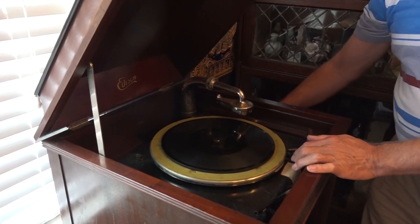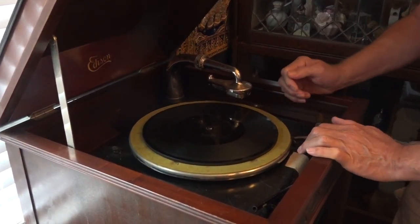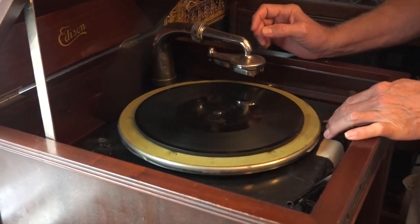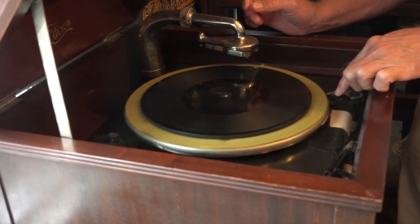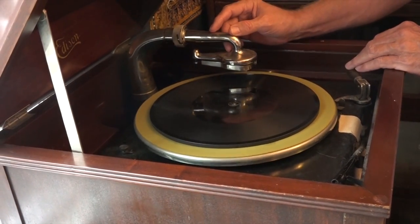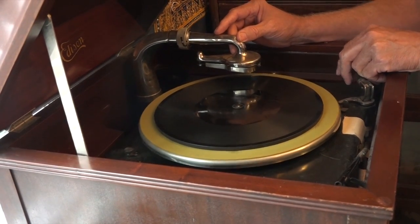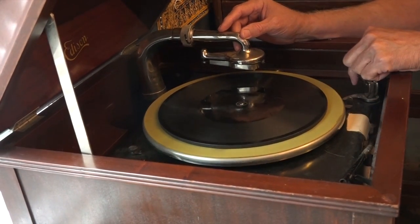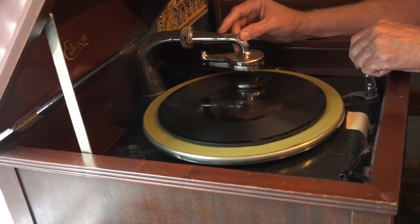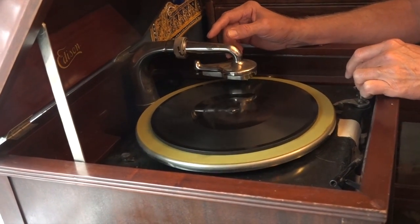The first thing you want to do is make sure it's wound up good so it'll be able to go fast enough. This is 80 revolutions per minute. You open it up by starting the record player, taking the friction off, and it will start going. You just have to move the tonearm by hand over to where it's about to start, because this doesn't really have grooves in that outside area. Then you lift this lever up and that will lower the tonearm.